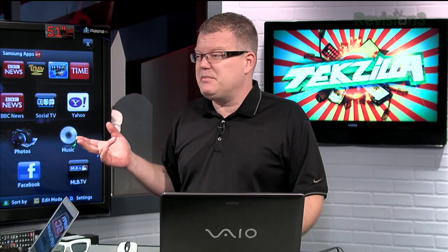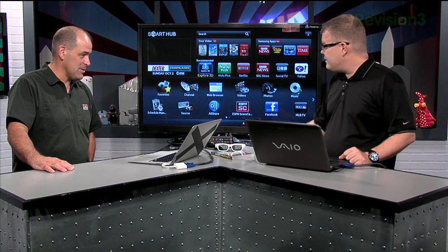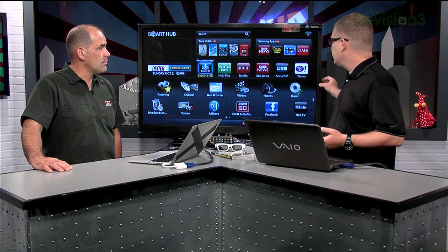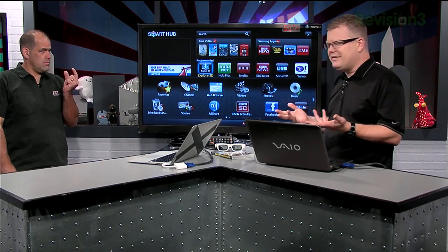Maybe not so much for gaming. I've found that plasmas in particular seem to be more prone to lag — audio delay in particular. The one I have at home requires me to set a delay of about 100 milliseconds to get the audio and video to sync up. If you're a hardcore gamer, you can't deal with a 100 millisecond delay. Otherwise, most people would look at this TV and go, oh it's an LCD — it's nice and thin, with a relatively slim bezel.